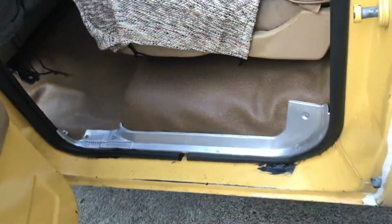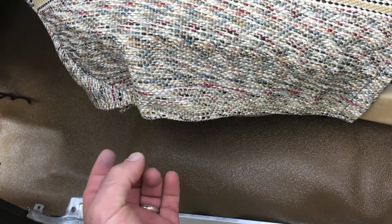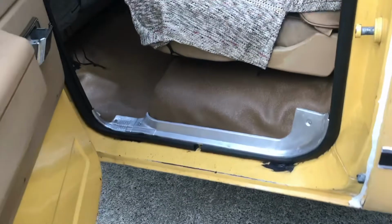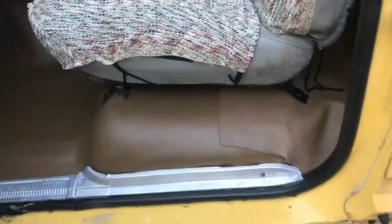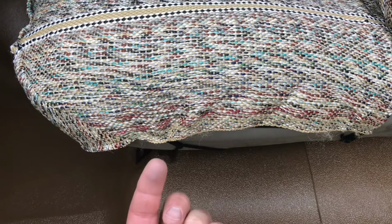The seat attachment bolts, so you can see where the hole is right there. When you get down to here, I believe the fuel tank is covering that up. But you can actually feel the hole. So just take a very small screwdriver or an awl, and stick it through there, and then draw a little circle around it. The front seat mounting, I had my wife put her hands on the carpet, not where I'm drilling, but just to hold it down, and you can get underneath it and drill very carefully through the hole as to not mess up the threads.